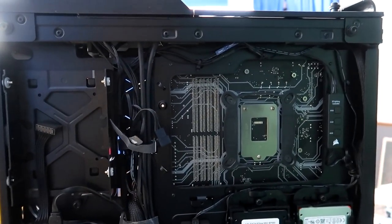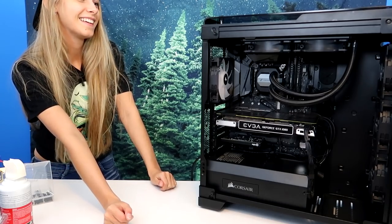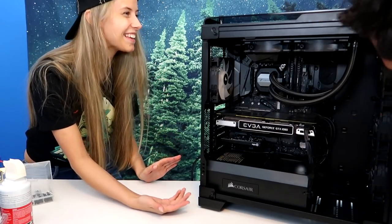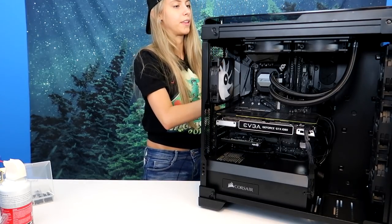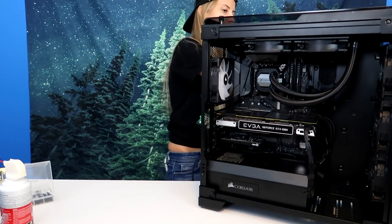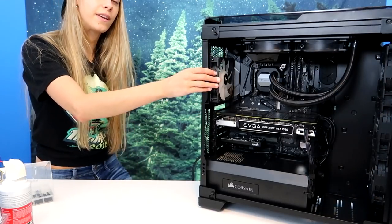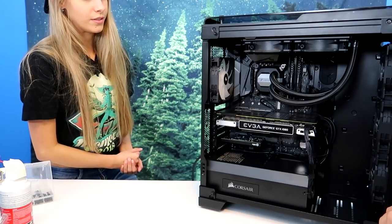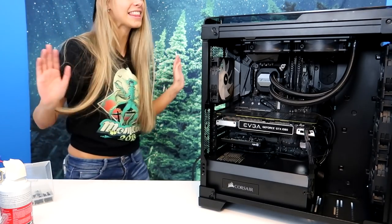Matt is on his way right now to pick it up — let's see his reaction. I'm kind of excited. Matt, you want to come see your PC and tell me what you think? They look so clean. Look at the cable management. You did such a good job! Thank you so much. I replaced the SATA cable — the reason it wouldn't post is because the SATA cable was one of the right-angle ones and it kept on interfering with the glass side panel, so I changed it to a vertical one. I did overall cable management, and I added an exhaust fan for you — you didn't have one. It's RGB as well. And I cleaned it. I mean, with the cards I was dealt, I think I did a pretty good job. You did a great job.